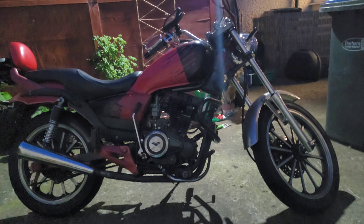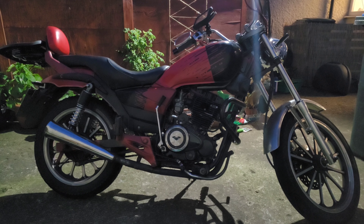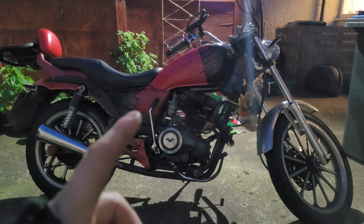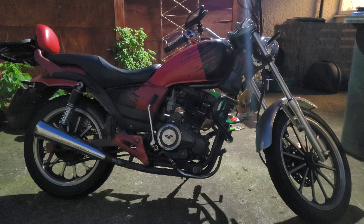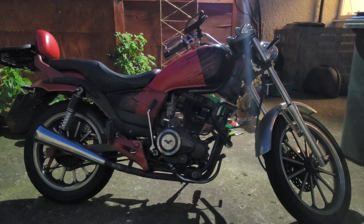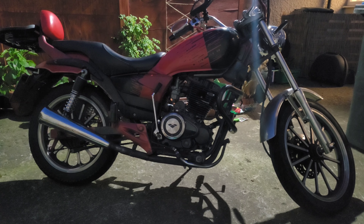Sitting out in the courtyard - I've taken this out for a wee run and it actually seems ok, although we're a wee bit short on the top end. We're reaching 55 max - this used to reach 65. So I think I'll need to mess about with the fuel mix, quite possibly we'll need a bigger jet on there, but we'll find out later on. So we'll take this out tomorrow and see how it handles a good few miles. It seems to be pulling ok, better than it was anyway - before this it was only reaching 40mph, so that was a big issue.